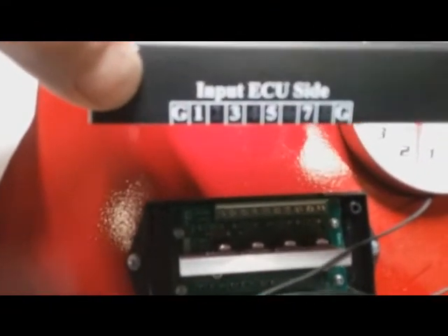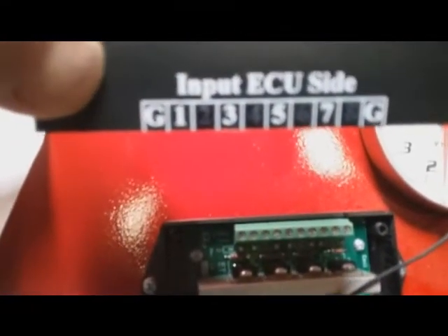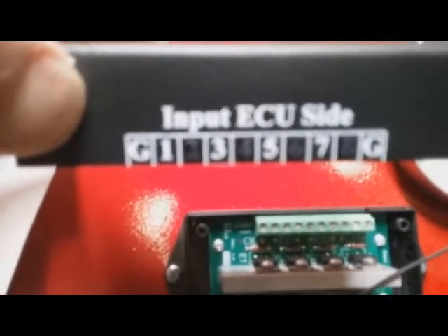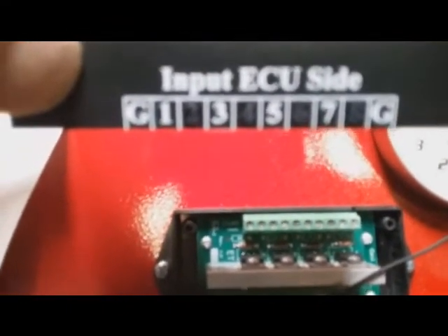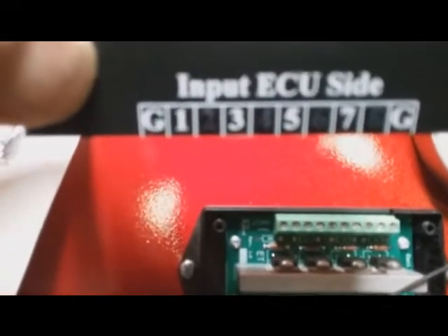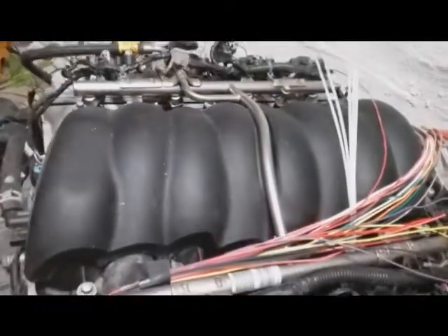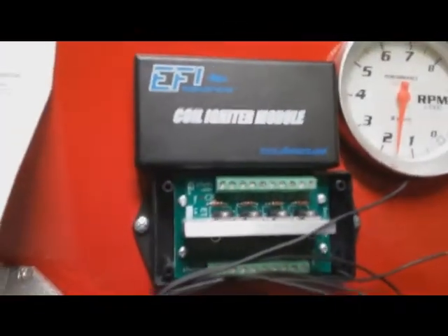All I have is one output — is it batch firing them all at the same time? And if so, how am I supposed to wire these up? I've got my ground, and since it was originally ordered for a four-cylinder, I think they blacked out part of the diagram to show four individual coils. Am I supposed to put them all in series, split the wire and go in eight times, or split it two ways for a batch fire from one side to the other?